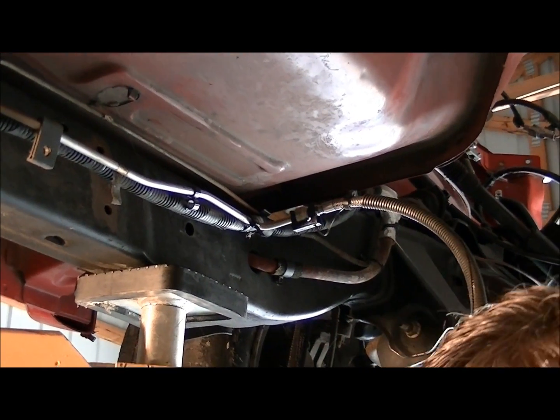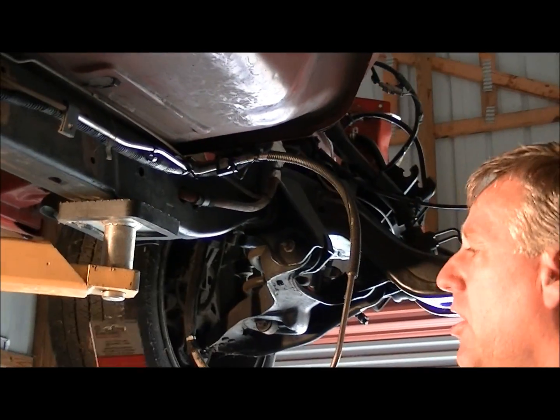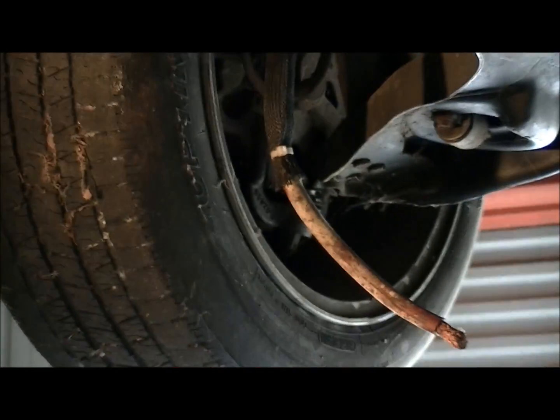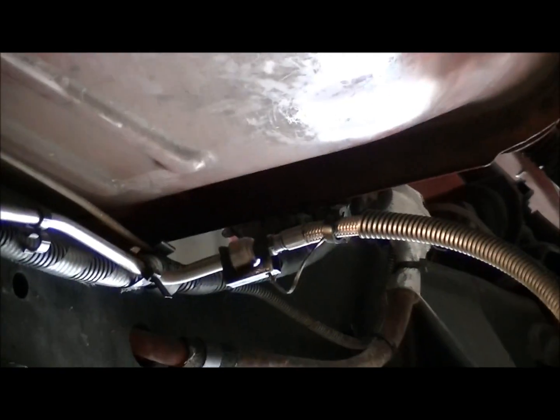They're easy to take apart but you do have to have a special tool. There's a tool called the 5/16ths fuel line disconnect tool. I got this at Napa — I think I paid about 3 or 4 bucks. They do come as a whole kit but this truck only has two connections so you only need the one single tool.